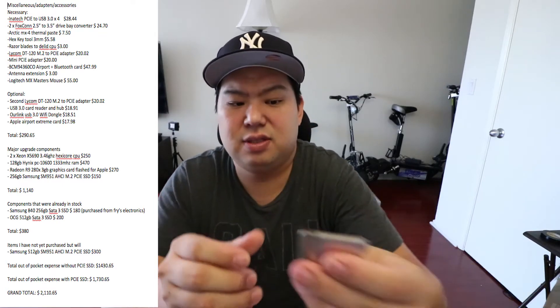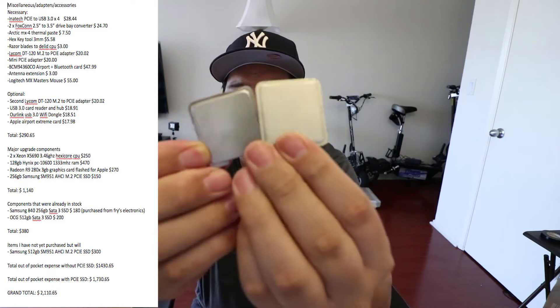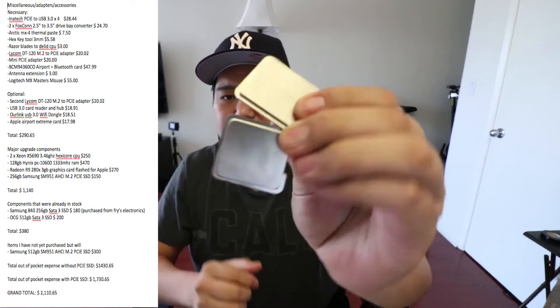It's such a great processor and you're gonna want that extra clock speed, especially because you want single-core performance to be as high as possible, and this one does very well. So $250 — not a major thing — but with this CPU it doesn't come de-lidded. With the 2009 Mac Pro you need to de-lid the IHS so you can install the actual CPU. You just pop it off.